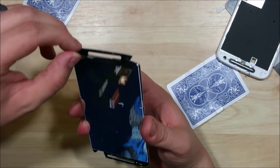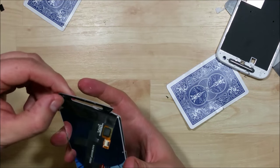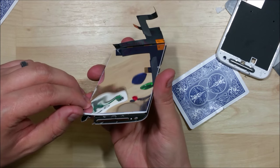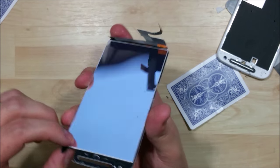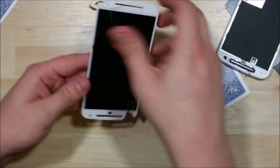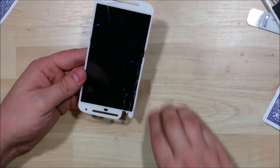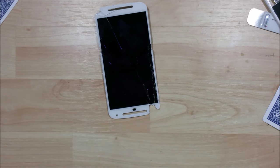Like I was saying, it does have an open backlight on it. So much like you'd see on an iPhone, it's not an AMOLED screen. If you're trying to do a glass-only replacement, it'll be a lot trickier. You can pull it back and see the open backlight. It'd be a lot easier just to do a full screen replacement with these — they're not extremely expensive, and after the cost of glue and glass, it'd probably be about the same cost, so I'm not sure it's necessarily worth the work.